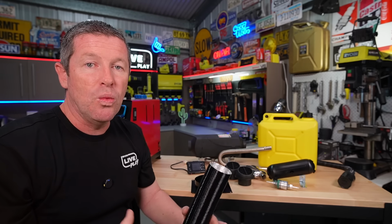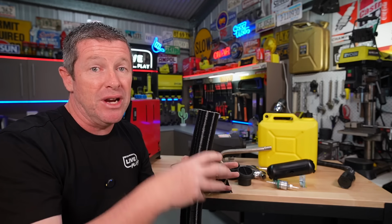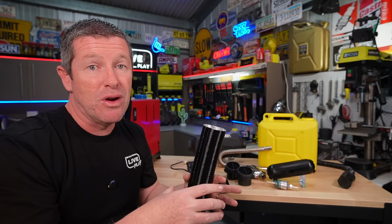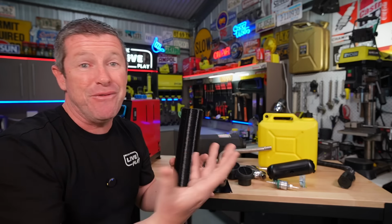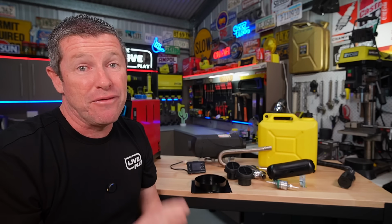So that's just a broad idea of what you want to look at when you're installing a diesel heater into anything that you're looking to do. And it's really, really important to get underneath and have a look at where all your structure and services run, because if you go to put the heater in and drill some holes in, they're non-reversible and you've got a whole heap of infrastructure underneath that stops things going in and out, it'll make your life really, really hard.